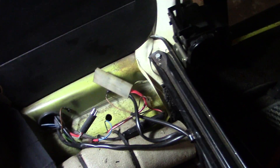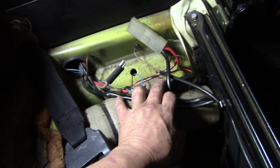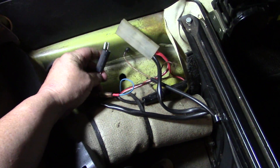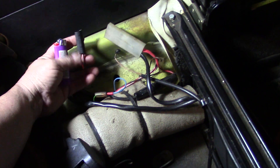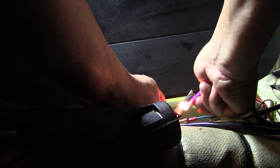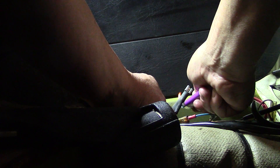You're going to have three main power wires on your regulator — a blue wire and a green wire. You're going to connect the blue and the green together. I just put a spade on the blue and plug it into the green. This is our other power wire. You'll have a gray wire that runs to the computer — you don't really have to hook that up, but I went ahead and hooked it up just because it was there. Once I get this heat-shrink done, we can plug this in and I'll go over what I used to connect these.